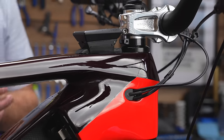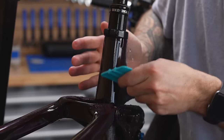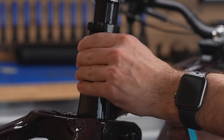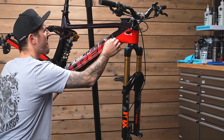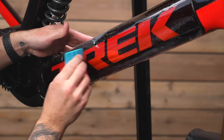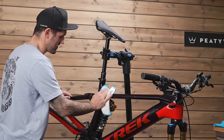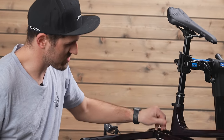You can be pretty rough with it - the harder you push, the more bubbles come out, which means less time spent pulling the piece back up. Down to the last piece. All wrapped, all the pieces are on the bike. I'm going to grab my microfiber, go over the whole bike, make sure it's nice and dry, clear off all the pieces. Then I'm going to grab my heat gun, just like before - any pieces that aren't quite stuck down, I'll go over those. I'm also going to go over every seam just to make sure it's all stuck, all heat locked. Then I'm going to leave it for about 12 hours before I ride it, to give the adhesive a really good chance to cure, and then we're good. Your bike is protected.